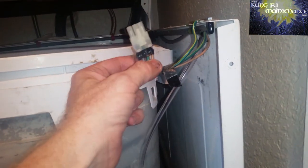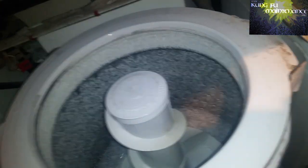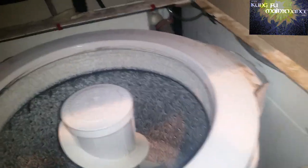I'm probably gonna need to plug in the disconnect for the lid switch. Test it. You could also use a jumper wire across the outer posts. The inside one is a ground. But for the fill portion, we can just make sure that it shuts off and does what it's supposed to do. And could zip tie this with a cable tie also to that deal. Yeah. See? Good here. And also tighten this one up a little bit so that it's a little tighter to the top part.